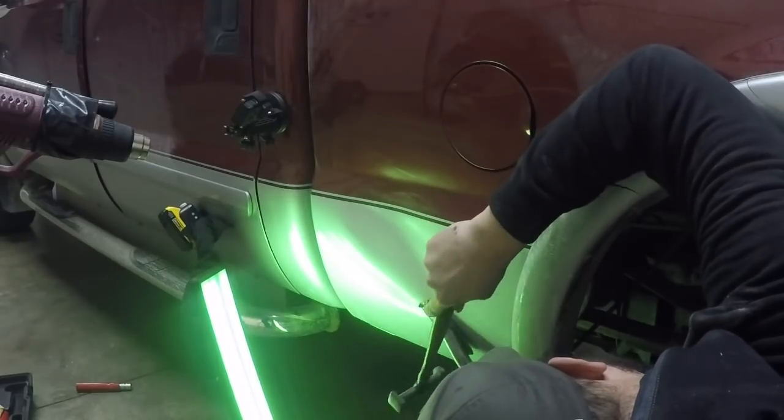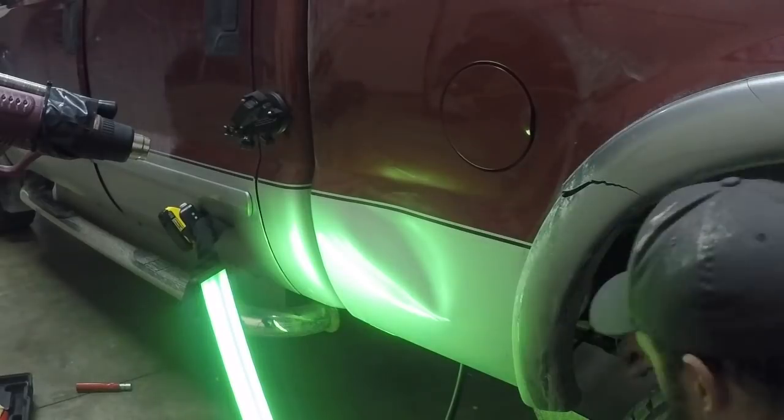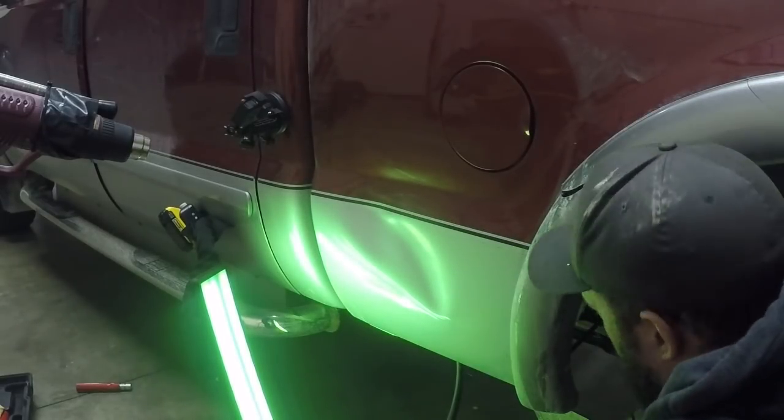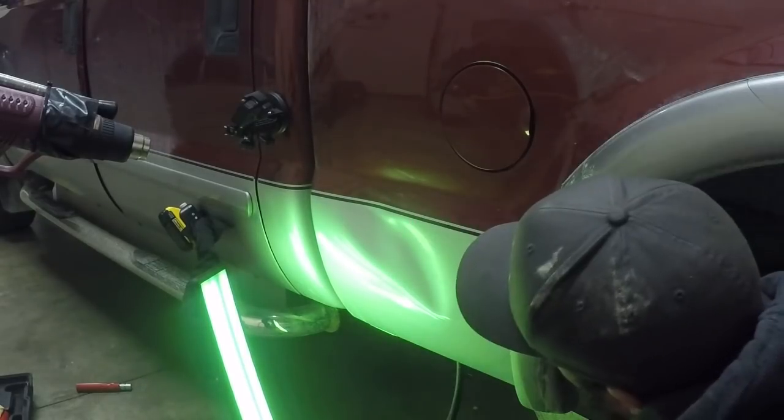As you've heard me explain with other videos, with that slapper tapper, I'm trying to put the metal back where it came from. Not thinking of it like a perpendicular motion, but more as making that metal flow where it wants to go. Coming up is a great part of this video.